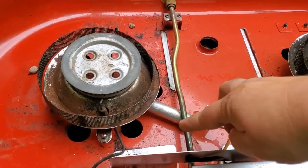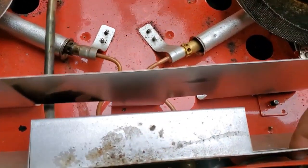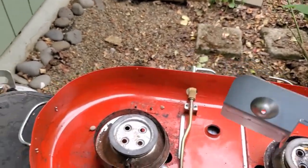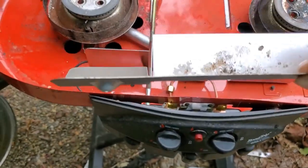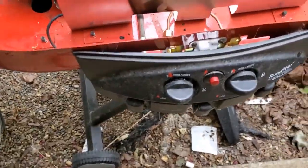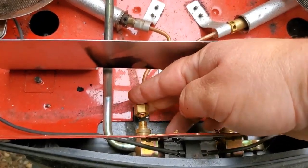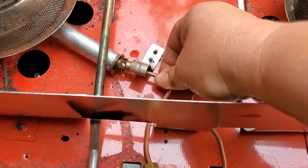Once inside, you can see the two burners, the gas coming in, and the venturi tubes. The next step is to push this forward to access two screws — one here and one right here — which allows you to take this part off. From what I understand, there were issues with flames melting the inside, so Coleman installed this in later models to protect the plastic surfaces from flames when venturi tube clogs happened. When you do that, it exposes the two connections, and I went ahead and unscrewed this connection using a pair of vice grips, which allows you to pop this out from the venturi tube.